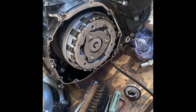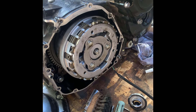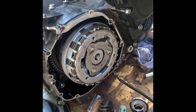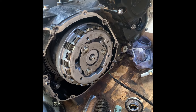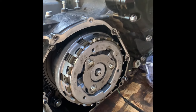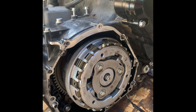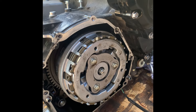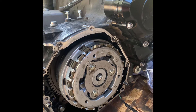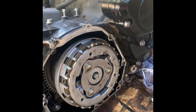Moving on to the clutch. This is the brand new 2021-style clutch with three bolts. The first version of the GSXS, the 2015-2016, had a basic clutch with no slipper functions. The 2017-2020 had the same slipper clutch style as the K5 to K8. This new one I haven't taken apart yet, but it'll be swapped out for our competition slipper clutch when this engine goes back together. Again it's all the same stuff as the GSXR K8, so these parts are interchangeable. I've fitted a K1 clutch into a GSXS with absolutely no problems.